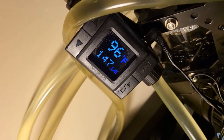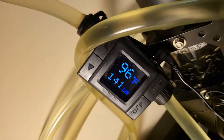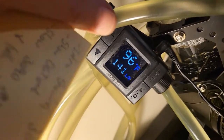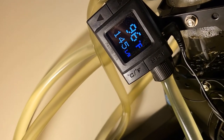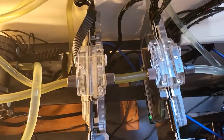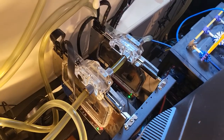I'll have a lot of this stuff linked in the description if y'all want to buy any of it. This little meter right here is amazing — pretty simple, I think it's about sixty dollars, but to me it's worth it. I can see my flow is about 145 on this pump, and I'm only using one side of the pump, but it actually has two sides if you ever need it. So I do have a lot of hosing in this. The fluid runs at about 96, which is really amazing for this setup. You can see both of these cards are just right beside each other. This is water cooled on the front and the back, and that's why the memory is so cool on this whole setup.